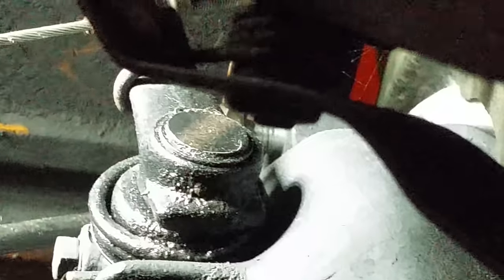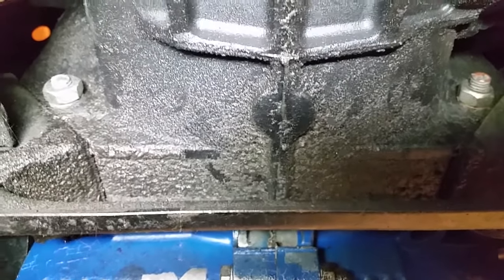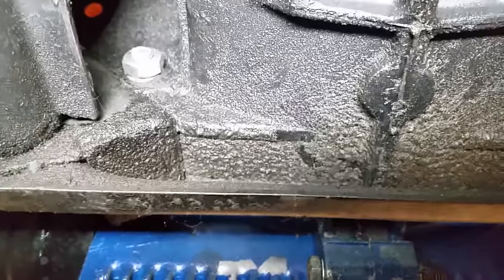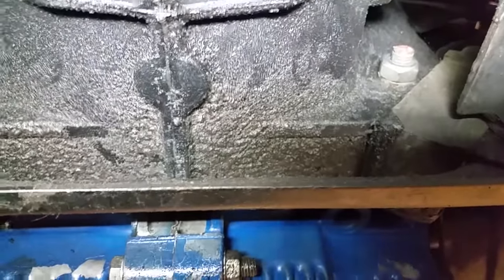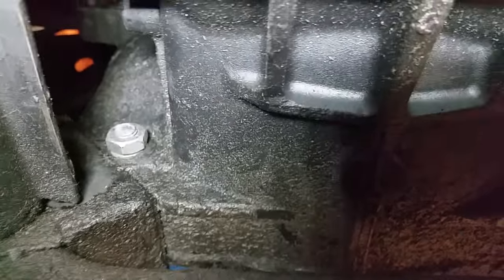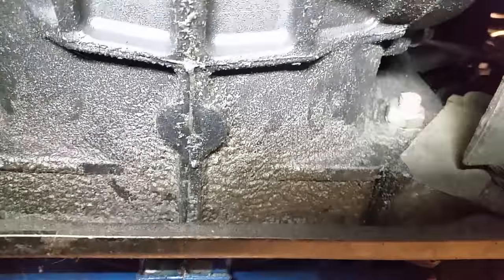On the driver's side you can see our clutch cable with the big wing nut on it. Also there's a bolt that's a little loose - that is your other engine mount point, that one just screws right out. Now here are your last two nuts - these are the bottom mounting bolts and both are 17 millimeters. Before you get to this point, check and double-check that everything is loose. When you take these two nuts out it won't fall right out because the splines on the transmission will hold the engine - you're going to have to push it forward - but these are the last two that hold it.